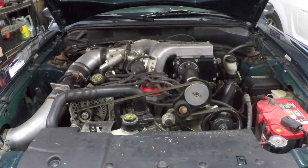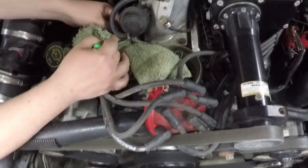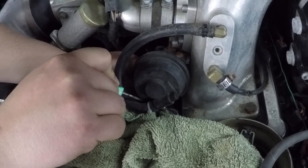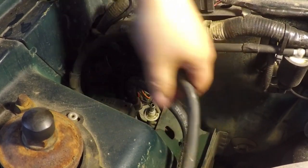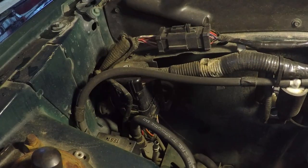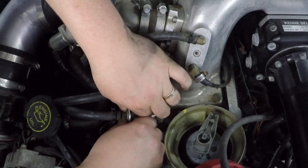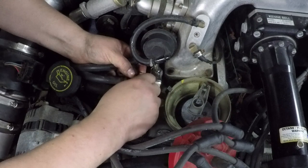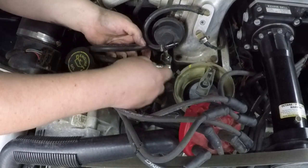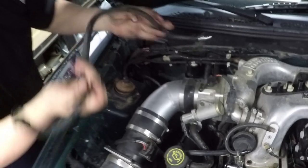The first thing to do is unhook your battery. Then discharge your fuel system using the Schrader valve at the end of the fuel rail — on the passenger side, simply depress it just like a bicycle tire valve and let out the fuel. Have some rags around to mop it up and dispose of them safely. Once the fuel system is discharged, you can begin unhooking the fuel lines — starting at the firewall or the fuel rail, your choice, it all has to come out. Use a fuel line disconnect tool at the rail; be persistent, use some WD-40, and these things will slide off. Once free, fish the fuel line out and take note of the routing.